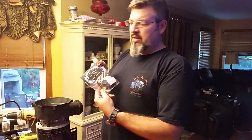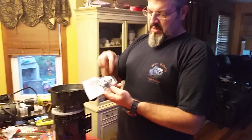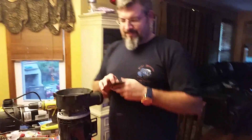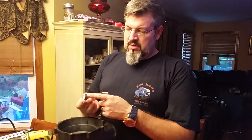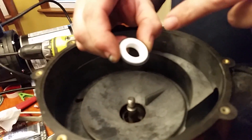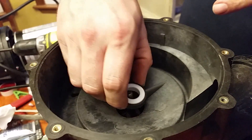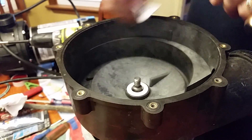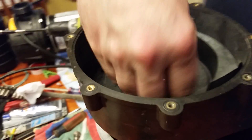It's got a brand new seal kit here — the housing and the ceramic seals that go inside. Here we have the new ceramic seal; it's got a rubber back. You want the rubber side to go down, so it goes in here. The ceramic part — you don't want to touch it, because if you touch it you get oils on it and it can burn up. So I'm going to use this piece of paper and push it in.